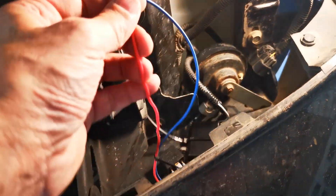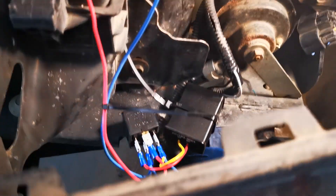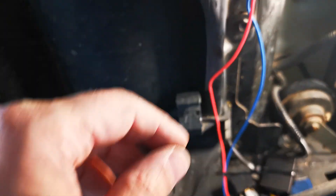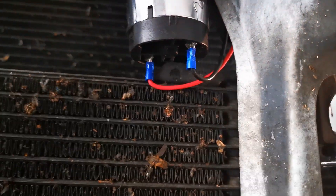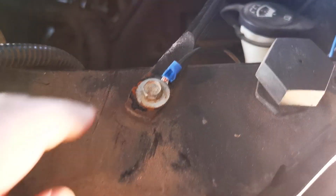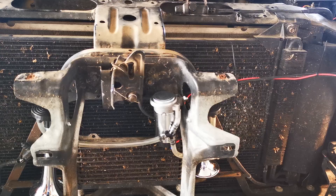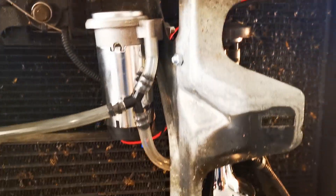The red wire out of our relay we wired up — you can see I ran it beside the black wire — and that goes to the positive. The negative from our secondary horn goes up and is attached to a strong body point where it's grounded.